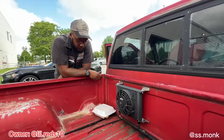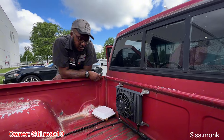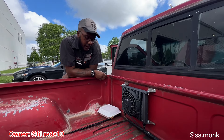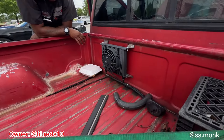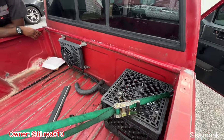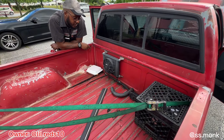The lines look good. They're all AN lines with the transmission cooler. I did AN lines with the fuel system too. What fuel pump do you have? I upgraded it to a 255 liters per hour. I got a Corvette fuel filter in it, and it's just a regular pump setup. I didn't think the stock 4.3 pump would work in it, so I just went ahead and put a proper pump in.